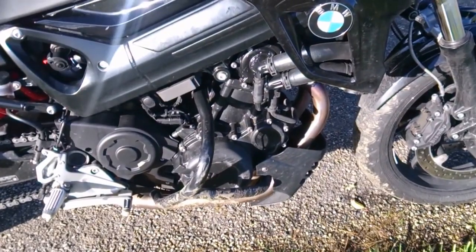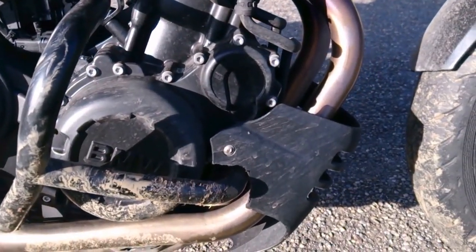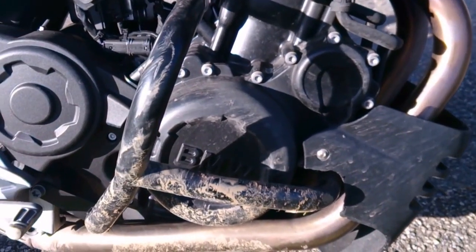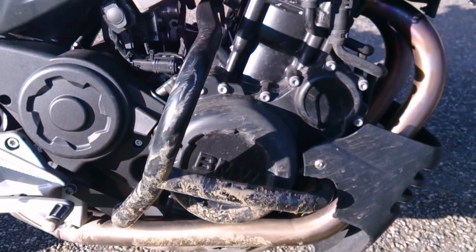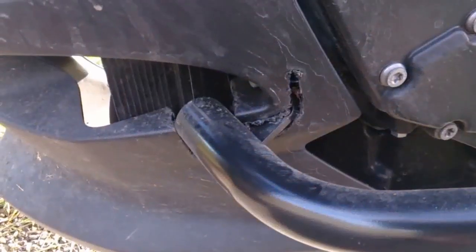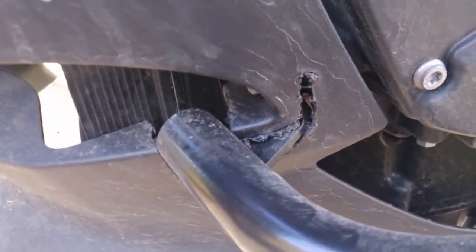Something I fitted myself is the crash bar — the motor protection bar as BMW calls it — very useful, as I found out for a second time today. There's also a motor cowling protector that goes all the way around. These two parts aren't meant to be on the bike simultaneously by the designers, but stunt rider Chris Pfeiffer uses the same setup. If you're handy with a small saw you can make them fit perfectly — I cut a slit into the motor cowling on the other side. I'll put a link in the description with modification instructions.